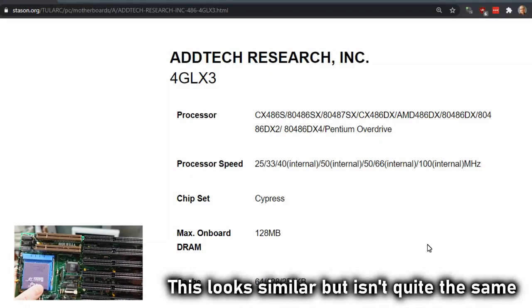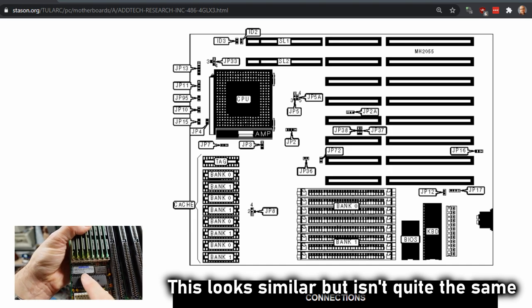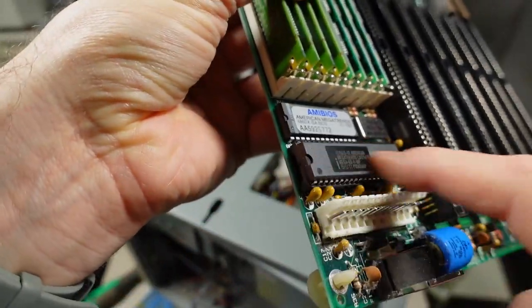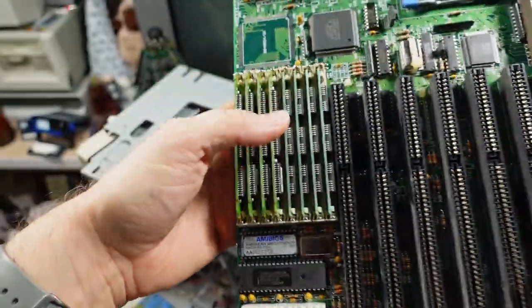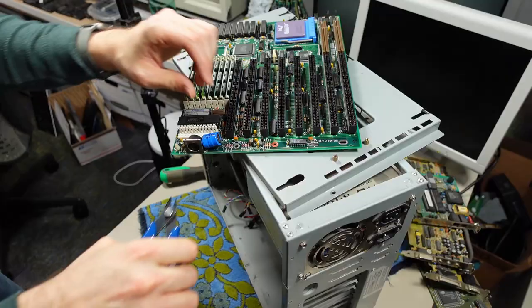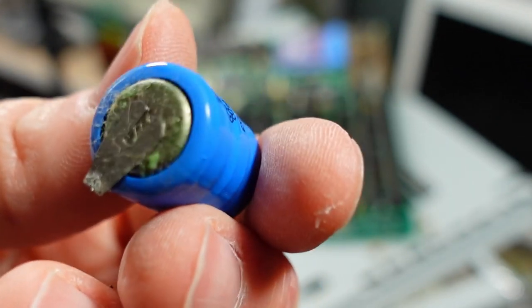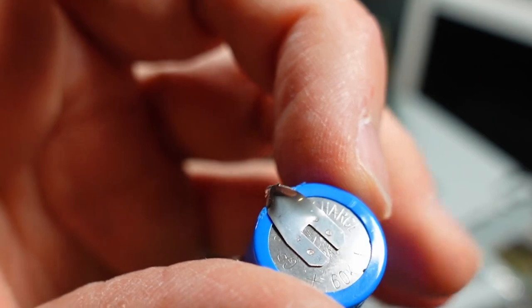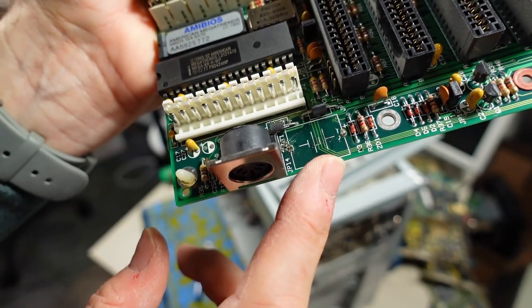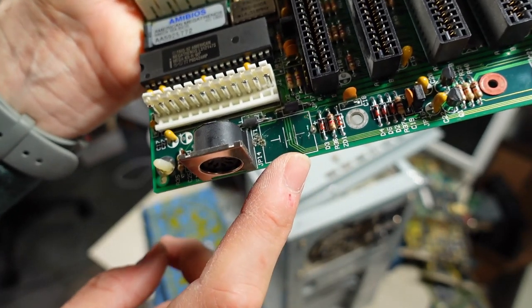There it is — Galaxy V3. That's really the only thing I can find on here as far as model numbers go. One thing I'm noticing is the BIOS chip is in the motherboard directly without a socket — that is extremely rude. Why is the keyboard controller in a socket but not the BIOS? That just means it won't be easy to yank it out and copy it. I'm snipping the battery out — it's just starting to leak, just a little bit of crust on the side facing the keyboard connector. I'm going to go over to the sink and hit this with a little IPA to clean it up. There's a little scratch on the motherboard from the cutters, but after cleaning everything looks pretty good — no damage. Those batteries destroy these boards, so if you have an old computer with a NiCAD battery, you need to remove that immediately.